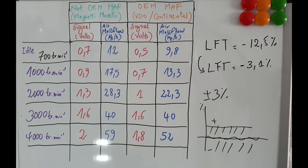Now for the explanation of all of this — let's focus on the values taken for both sensors. You can quickly notice that the voltages sent by the Magneti Marelli were slightly higher than the voltages of the VDO MAF sensor. The difference between the two MAF sensors across all RPMs is about 0.2 volts, and this is significant. Based on the voltages, the ECU calculates the amount of air going to the engine and then calculates the needed amount of fuel to be injected.